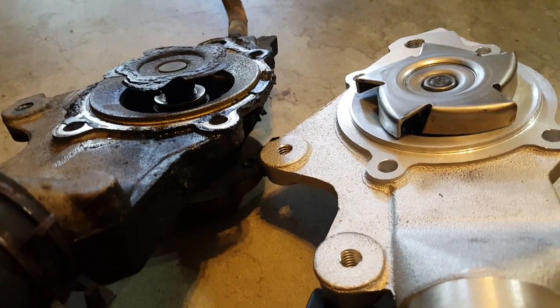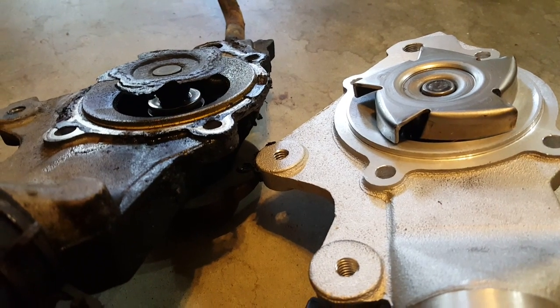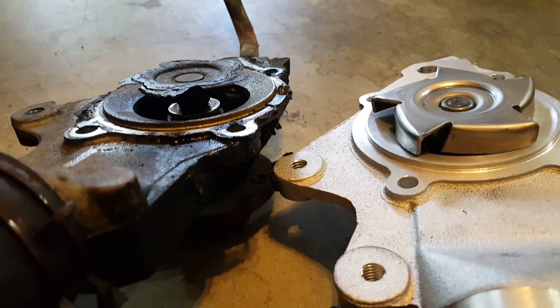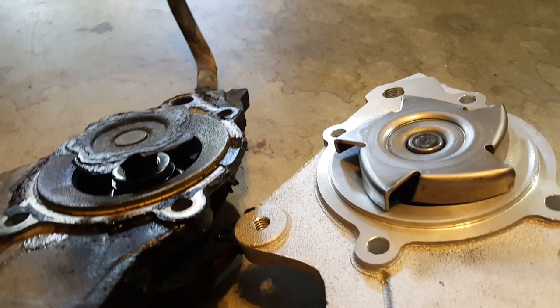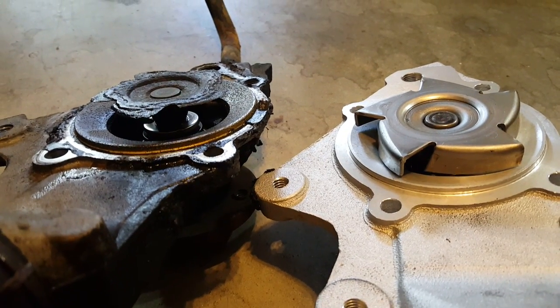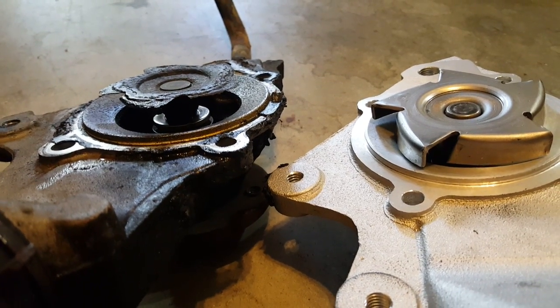The 97 to 01s were really bad because most, if not all, had California emissions and had the catalytic converters in the manifold, right beneath the intake manifold, so there was a lot of heat buildup. I kept having all these problems with overheating and it got really bad on the first warm day here.